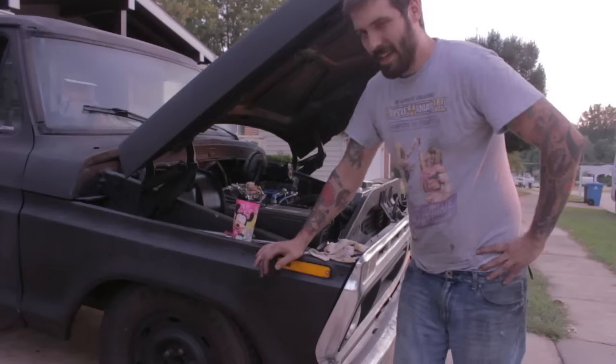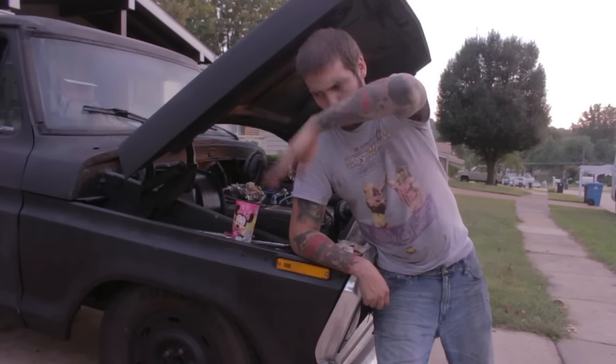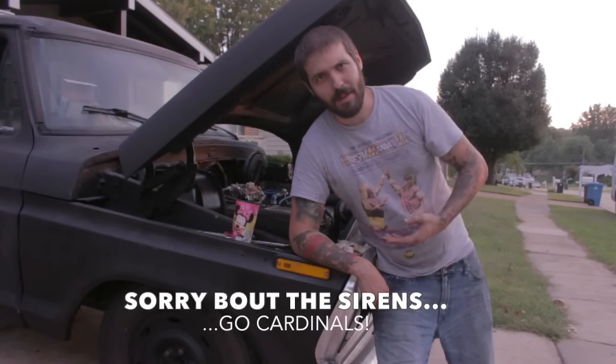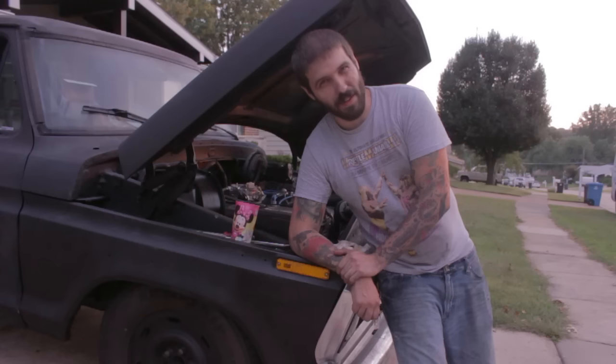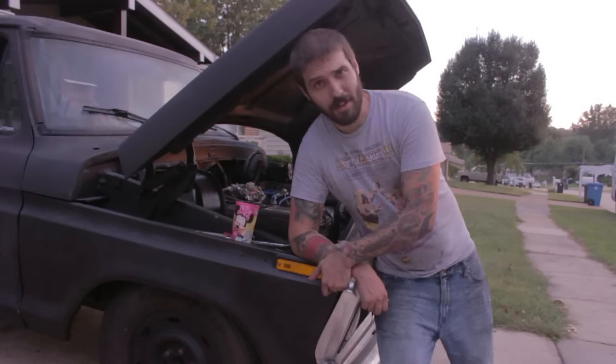So, the Holley obviously had issues and came back off. Dad spent a day rebuilding the Edelbrock with a kit that we got from O'Reilly's. Found that the floats were just thrown in there, not set at all, just hanging out. So, gonna work on that and try to see if we can get the Edelbrock drivable. Probably won't be able to tune it up right, but can at least get it to where I can start driving it instead of it just sitting here in the garage.